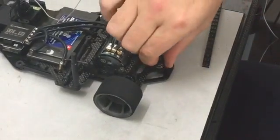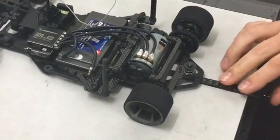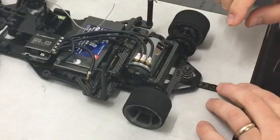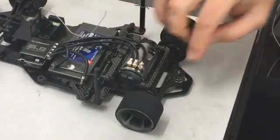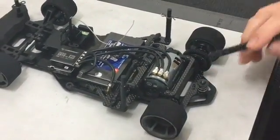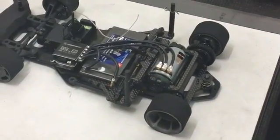So we very simply just unwind the collar again to lower the chassis back down until we get 3.6 millimeters, like that. And then we have 1 millimeter of pod droop on our rear suspension. Now when I want to adjust the ride height, I don't touch the collar anymore. I adjust the rear axle carriers to higher and lower the axle.